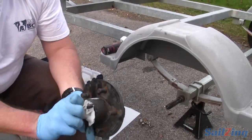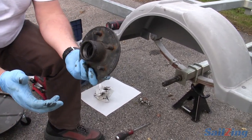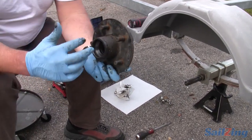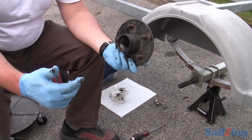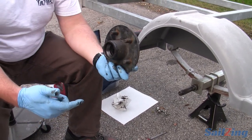One thing we can do at this point — if we're cheating — is go to Tractor Supply, Northern Tool, or West Marine, which all sell this hub with grease in it, new bearings, and a new seal — slide it right on and go. Because it's got the easy-lube dust cap, I think Northern Tool is the only one that sells it with that cap. That's the cheapest bearings and grease, but it's way better than doing a bad job. That whole unit costs $40 to $50. There have been a bunch of times in my life where I've just said, that's the play. If you were on a trip somewhere, that might be the way to go — get it replaced quickly, then repack your own later.